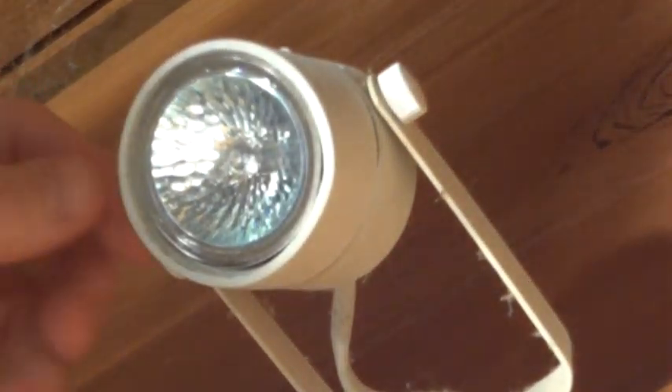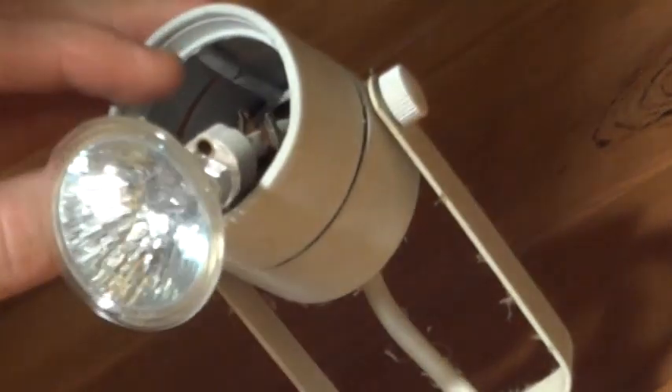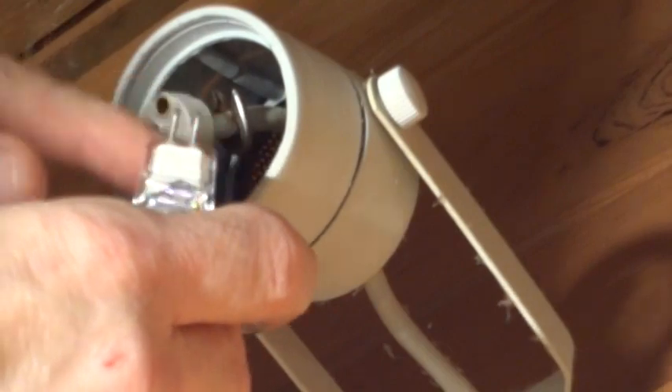Now the light's here. Push the wire in through the back. Once the light comes out, you can kind of pull it out. There's a little porcelain connector out here that the light plugs into. And make sure that the power is off when you're messing with this stuff. So just unplug the little light — there's two little prongs on here — just go ahead and unplug that out of the little porcelain connector.